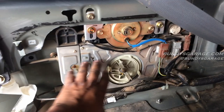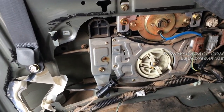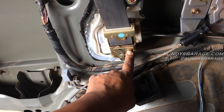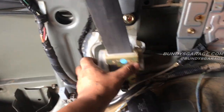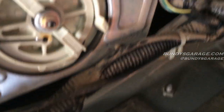There was no way I could sneak my arm in there, and I didn't want to mess with all the sliding door mechanism. So what I did — there are two bolts that hold in the rear seat belt mechanism: a 14-millimeter on the bottom and a 10-millimeter on top. I got that out of the way, cut off some plastic, stuck my arm in, and worked it all the way up to where I could feel the sensor and just took it out.